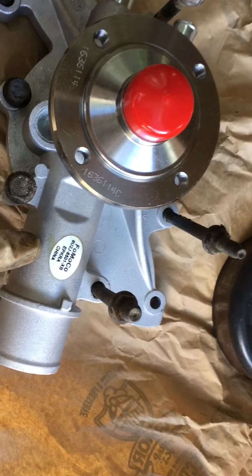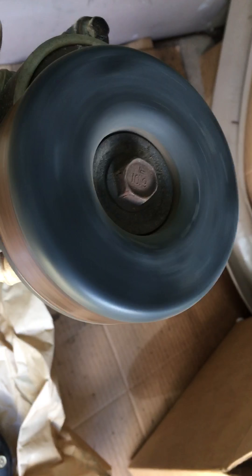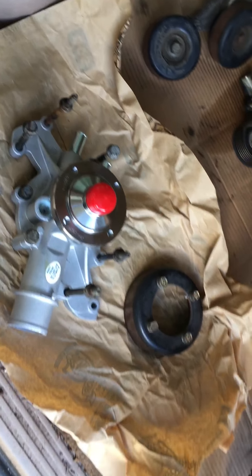Here's our new water pump. Here's the pulley that goes on it. There's the missing slot for the hole. Every single one of these pulleys is junk — they're very gravelly and they spin profusely, which tells me they're junk. Luckily, I have a parts truck on the other side of the yard that we'll be using for that. All three pulleys are garbage and will be swapped out accordingly.